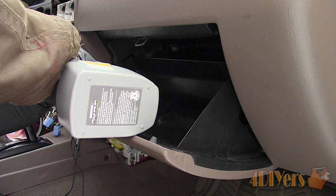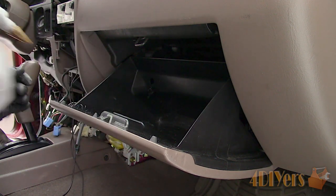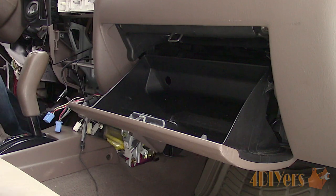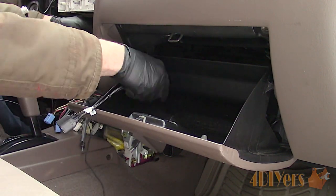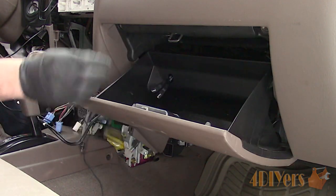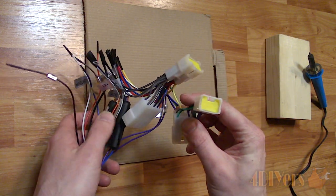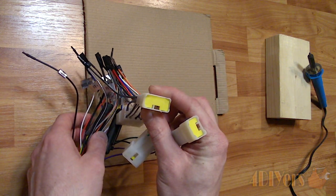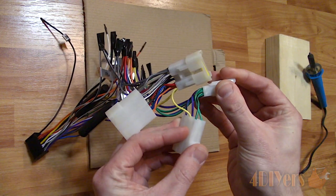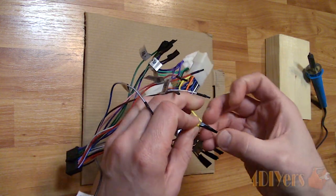For the external dual USB hookup, this was run in the glove box — though it can be mounted anywhere you'd like; the center console would also be another option. Using a step drill I picked an appropriate size for the wires and drilled a hole in the back of the glove box. The wires were then cable tied together and fed through the hole over to the radio opening. For the head unit's wiring, as mentioned earlier I did cut off the ISO plug on the harness as it's not compatible with this truck. There are inline fuses which is a nice safety feature so I'd like to keep those. The Tacoma has quite a bit of room inside the dash, especially since the new head unit is shallower, so there shouldn't be any issues pushing back that wiring.